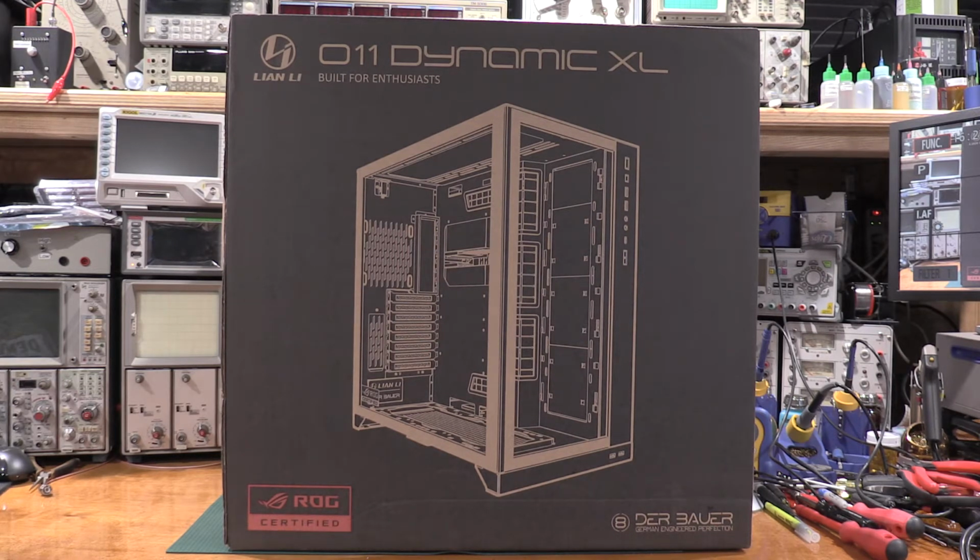So the plan for this video is I need to transplant my editing computer from the current case that it's in into this case. Back in March, when everything started blowing up, I had to do some things real quick and I didn't have enough time to research parts as much as I'd like. There are some struggles in the editing computer in the case that it's in currently. The main one is I need room for 2 more 3.5-inch drives so I can set up a RAID 10 array in it. That'll help with the editing and things like that. So this will support the 4 drives I need for RAID 10. The other one only supports 2 drives, can't use RAID 10.